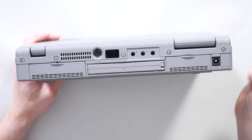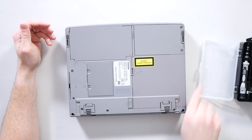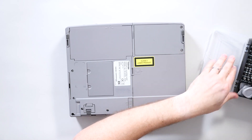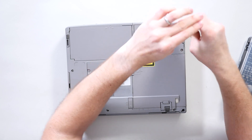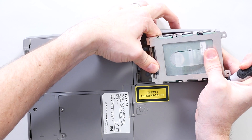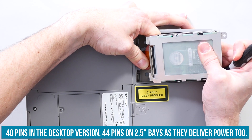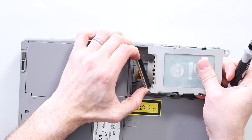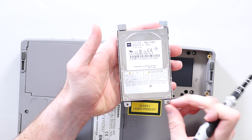Be wary of docks — USB port replicators are much better these days. Fortunately, huge chunks of laptops tend to be quite easy to take apart because they are the user-serviceable parts. Let's start with the hard drive. This is a parallel ATA, PATA or IDE hard drive, which has the big 40-something pin connector. You've got to be really careful because the tendency is to try and pull one side off first and end up with bent pins.